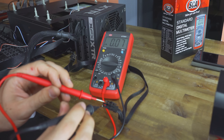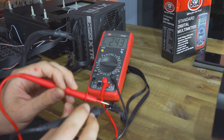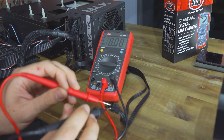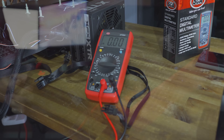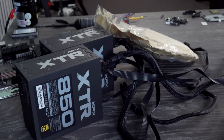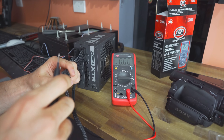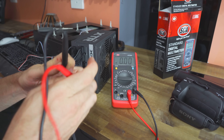Success! Getting past proprietary modular power supply connectors has never been easier — just flip it upside down. And according to you guys in the US, in Australia that's apparently normal anyway. We did the exact same trick on the other power supply, this time with a Corsair CPU 8-pin, and it worked exactly the same as the Thermaltake 8-pin — flip it upside down and it's now working correctly.